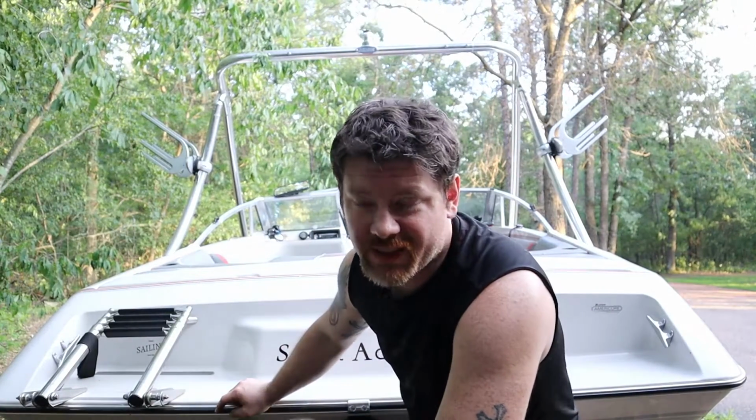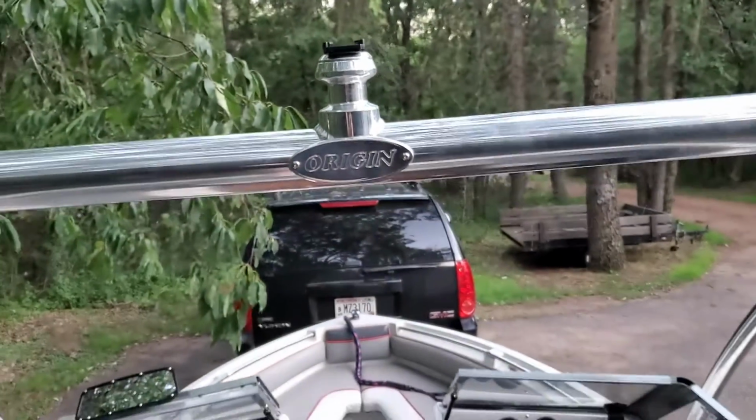Now, also speaking about towing, that is one of my complaints and something I actually didn't realize. You cannot ever, under any circumstances, pull a tube from that tow point. Apparently, a tube creates a vacuum or a suction cup effect underneath the tube. So when you're yanking or cracking the whip on a tube or anything like that, it adds tremendous pressure on the system, and it can and most likely will cause failure in the wakeboard tower. And I will show horror photos here.